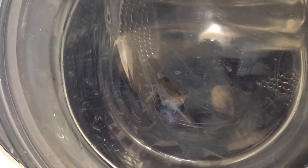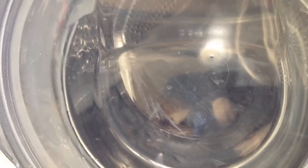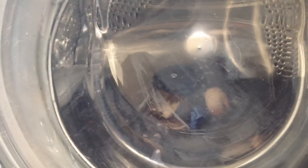We can see it's making a noise like it should be turning, but the drum is not turning very well. There it's been a bit of a jerk - didn't turn, then eventually it did turn. Rather erratic behaviour. Now it's having real trouble actually turning the drum; as you can see it didn't even do a full rotation there. It's one of the symptoms of the problem and I suspect it's going to come up with the error code in a minute.